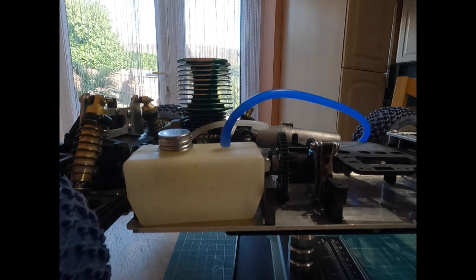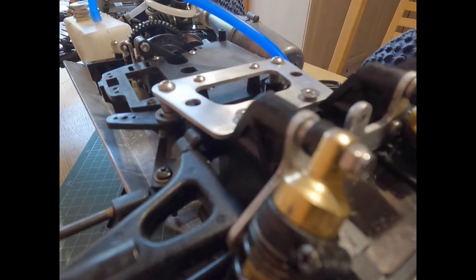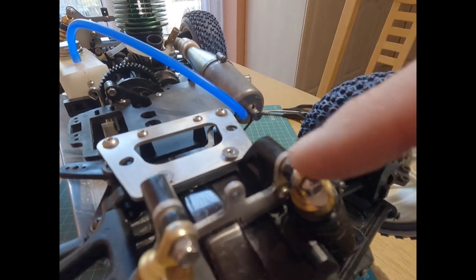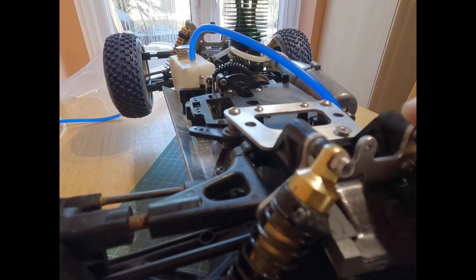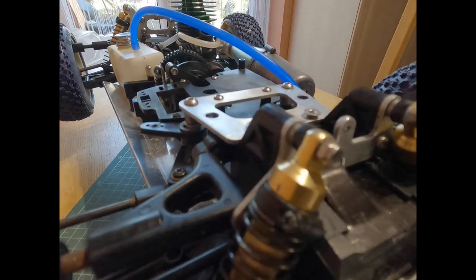So to conclude this section: more things need to be purchased and we're still unsure about the fuel tank. As it is a slight leak, I personally don't think it will work, but it might just do enough. There is another bit I need to do, which I might do now because it's one of the things I put to one side and never got round to. That's these end pieces here - they're on the top of the shocks. The hardware in there at the moment is stainless steel hardware that goes through, but they're not long enough. I need longer ones because the bolts just aren't grabbing the thread properly and they will come undone.